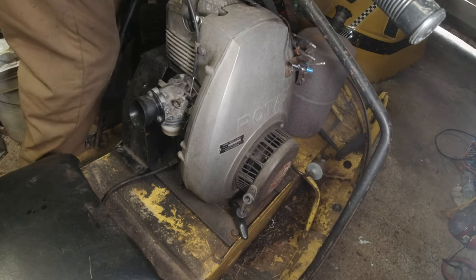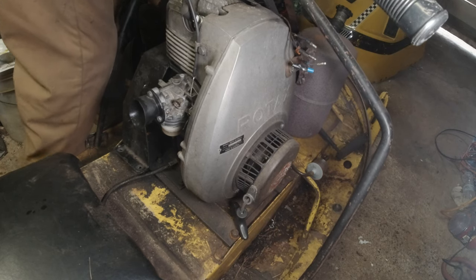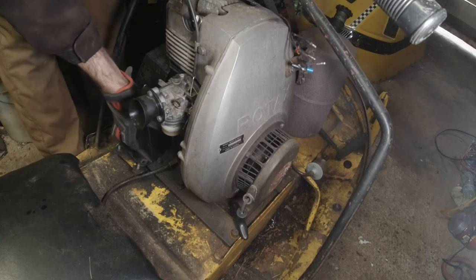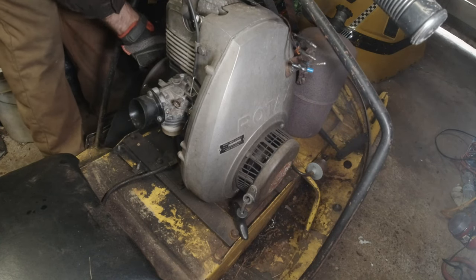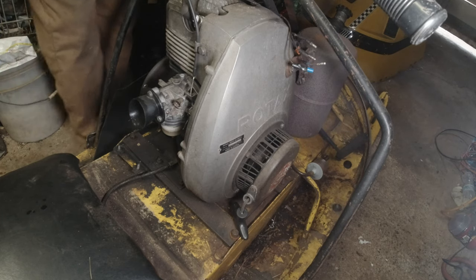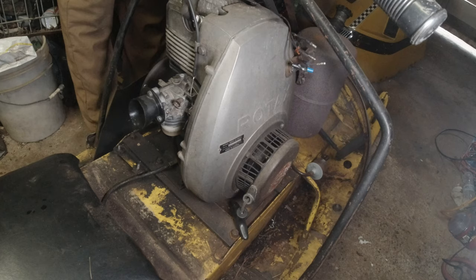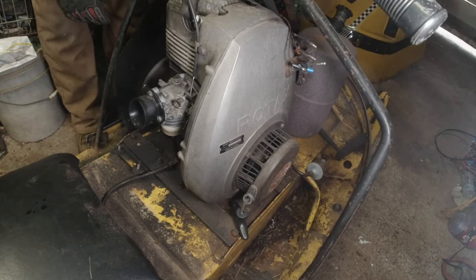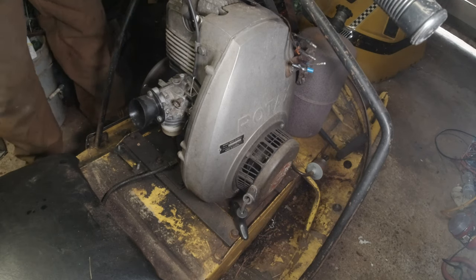It's been a while since I had this one apart. It's been running pretty good, with a new belt on it. That was one of the issues this one was having, the drive belt was too worn, and it wasn't just this one, my 67 too. The drive belts were too worn and weren't able to engage when it needed to. Belt cover.